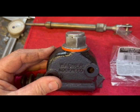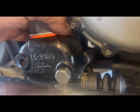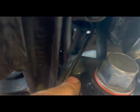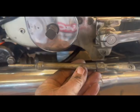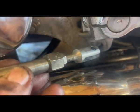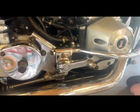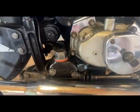Let's get this thing on the bike. Pretty straightforward — bolt it in the back on. You got two long bolts, you got two spacers that go behind it. It bolts right directly to the frame there. Don't forget you have to screw in your line right there. We got in there — just go ahead and tighten it down. Your rod goes back in. The small end obviously goes into the plunger in there and that fits right underneath there. You got a little pin that goes through there. It's a little tedious trying to get that through there, but get it through there. It has a little cotter key, locks it in place, and boom — you got the rear brake on there and it works.